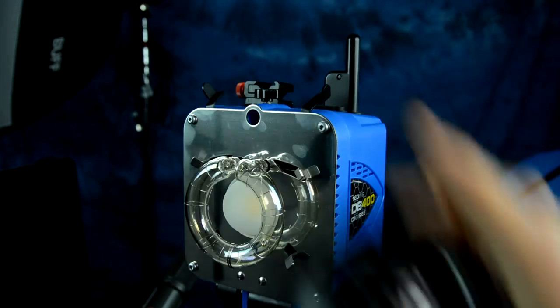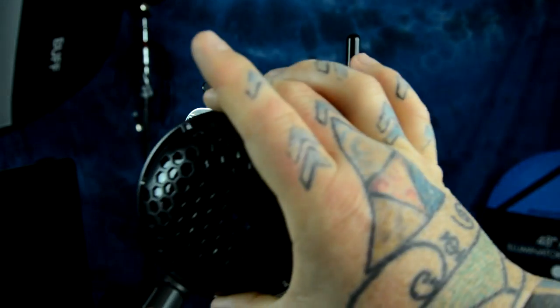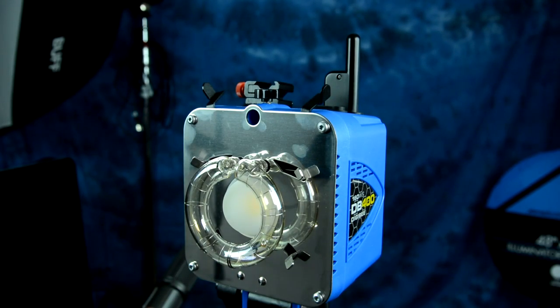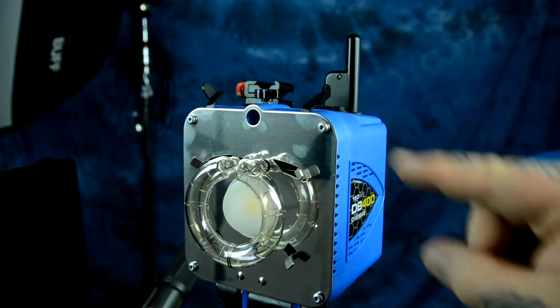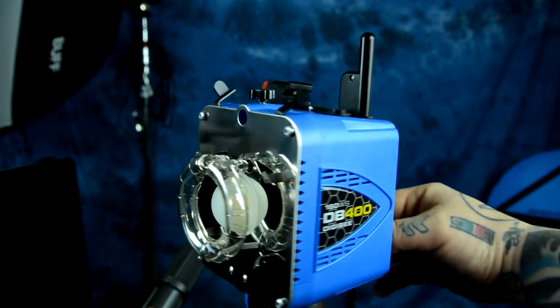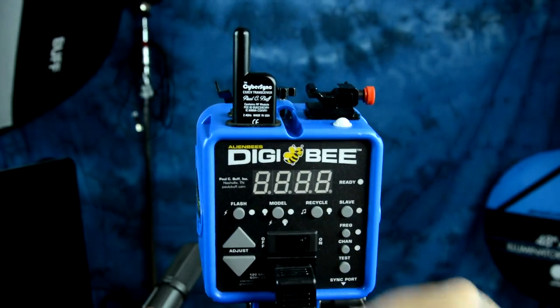And this is the protective cover. Never store this away for travel without protecting your xenon flash tube here. And make sure you don't touch your xenon flash tube. If you do, make sure you completely unplug the unit and you wipe that oiled fingerprint off, because all fingerprints have a little bit of oil in them, of course. And so that is it.